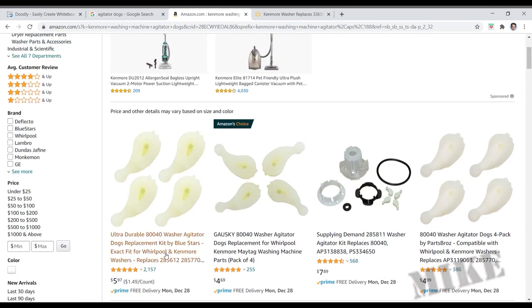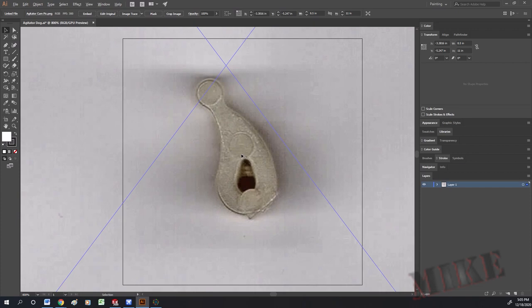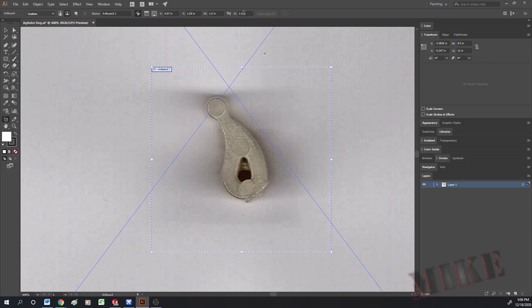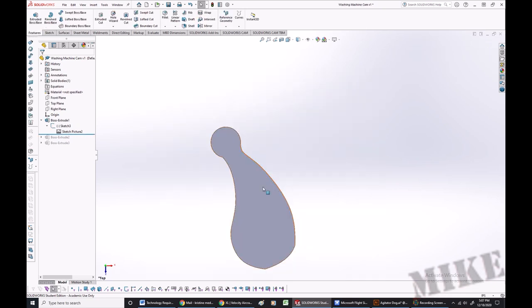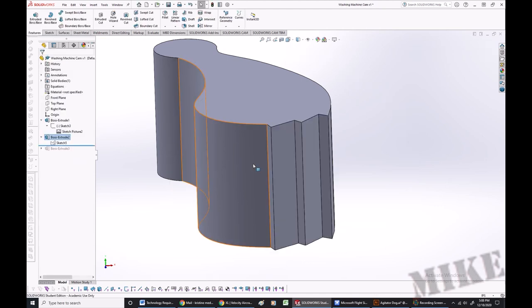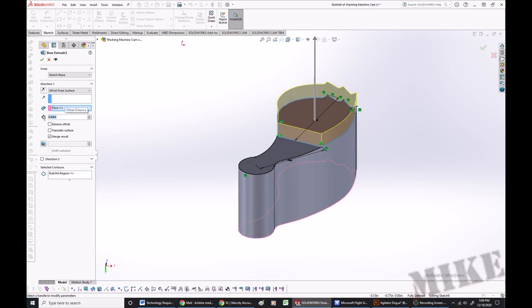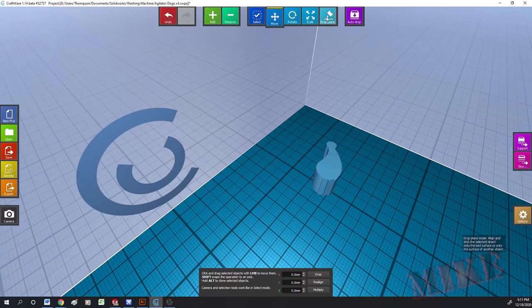So I scanned one of the dogs, resized my artboard to one and a half by one and a half, and now I can import this into SolidWorks as a sketch picture. I've traced around here with some splines and extruded it — there we go, gets some extruded teeth on this end. And then I need this little piece on the top — extrude that. Save it as an STL and we'll go print it.